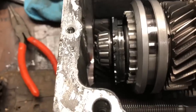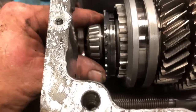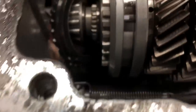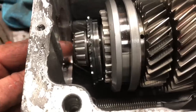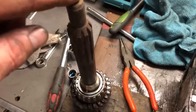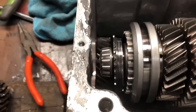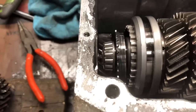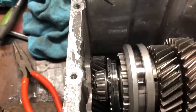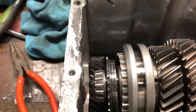It also uses a special input that's made for that bearing. A popular modification is when you burn the shaft on a regular T5 - which has the 15 roller bearings - people will machine the shaft down and press one of these bearings on, then buy a Fox version of this input, and you can still get those and kind of save the main shaft. I'll get the numbers off one of the gears and we'll know for a fact what we have is a 295 Z-spec T5.